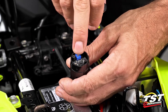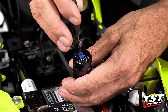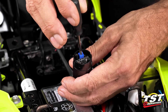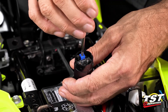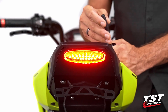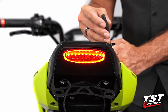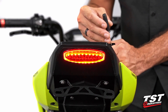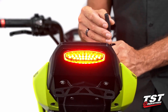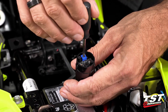For rate adjustment, use the potentiometer with the brake pressed — turn it clockwise to make it go faster, counter-clockwise to decrease the rate. In brake alert mode you'll only have nine flashes to make your adjustment and then it'll stay solid. This mode doesn't lend itself to really fast flashing at the top of the range, and the bottom of the range is unusable, so I like to set it somewhere around three quarters to maybe 80 percent clockwise.